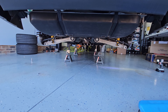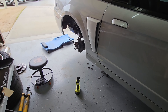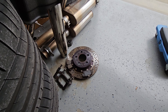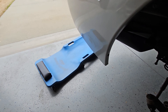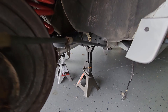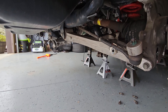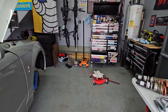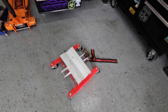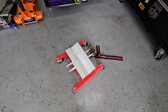Now all I've got to do is unhook the brakes, unhook the drive shaft, and then start dropping the IRS. We're back and about ready to pull the IRS out of the car. Got the shocks out, brakes off, exhaust off — which took way longer than expected — drive shaft is unbolted. Pretty much the only thing left is to drop the IRS, which is only four bolts, but it's really heavy. I've never done this before. I have a transmission jack which I'm hoping will balance the IRS well enough so I don't drop it on myself.